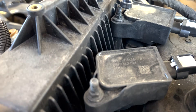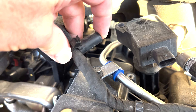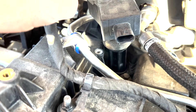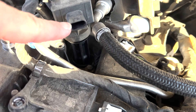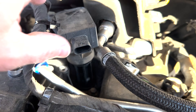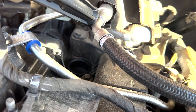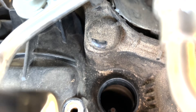Actually, that little bolt is not 10-millimeter, it's 8-millimeter. On the back one, it has a little push holder that goes over it, so it looks slightly different than the ones on one and three. What you're going to have to do on that one is unplug the connector here — just push it back with your thumbnail and pull the whole thing off. You have to disconnect it because it's sitting underneath this pipe, and you'll have to rotate it and pull it out to get access to the spark plug underneath.